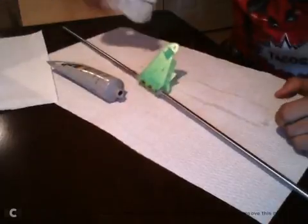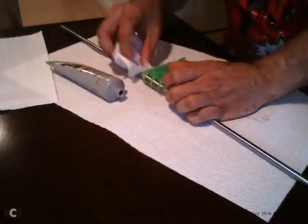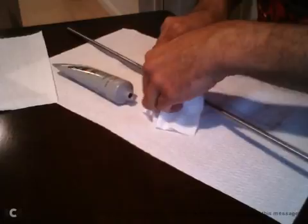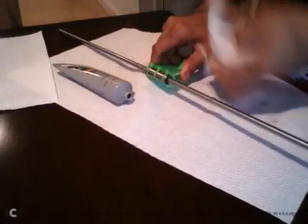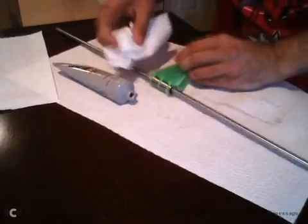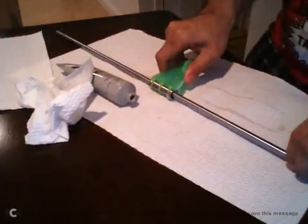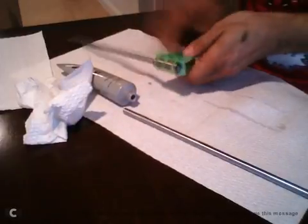I can't really tell if the grease is coming out at the interface or if this is just a minor seal being breached on the side. Some bearings have a leak seal so that any overpressure can get relief — so they don't damage the bearings. But now you know your bearing is primed with grease. You pull out one rod and see it's actually pulling the other one in because of the vacuum.